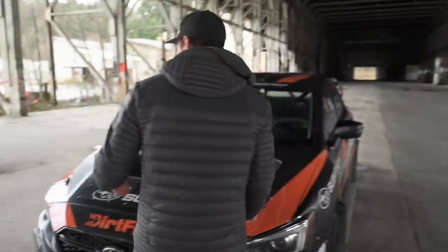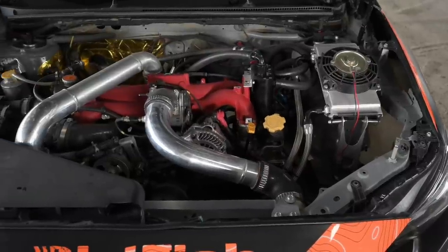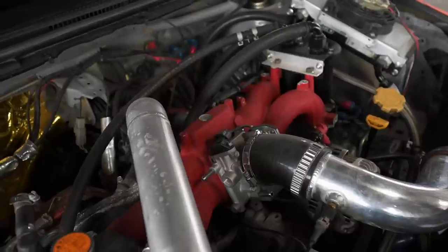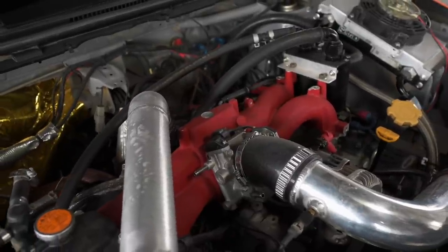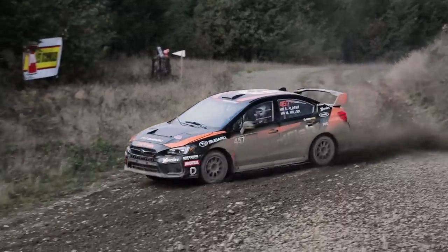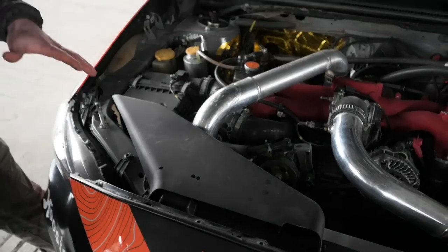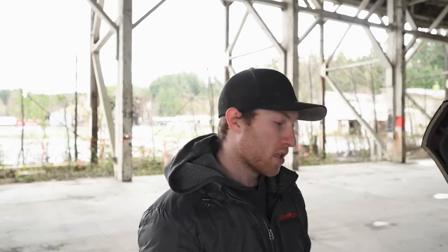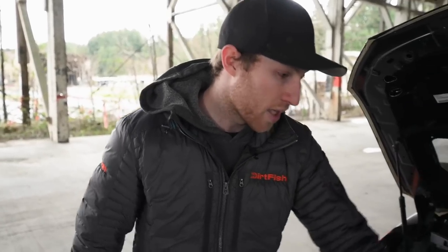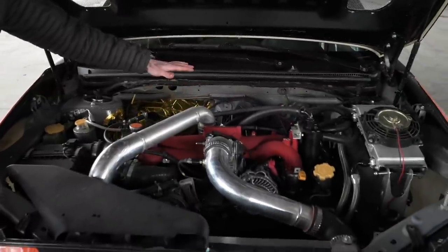Starting underneath the hood, we've actually backdated the engine — we're using an EJ20, a 2-liter. It's a little bit stronger in our thoughts. A lot of things are simplified. Our intake piping is super short, which means very good throttle response and torque. With the rotated manifold, we're running a front mount intercooler, and that's going to help mostly our intake air temps. The colder the engine is, the more power it's going to make. It's really good to get the intercooler in the front instead of up top where a stock car has it, where it gets heat soaked from the turbo.